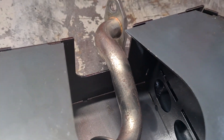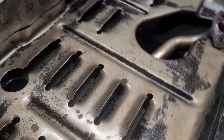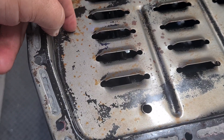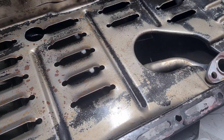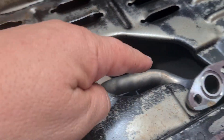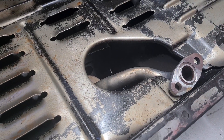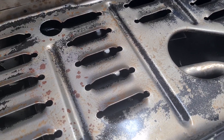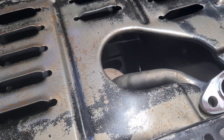It takes a standard pickup too, so no special pickup required. These are oiled to ship and store so they don't go rusty, but even so, you do need to give it a really good thorough clean before you use it. If you have dirt or debris in there, it will get sucked up through here and go into your oil pump — that'll equal a bad day. Give it a really good clean, flip it upside down, flush it around.